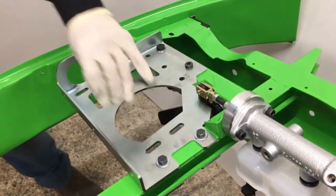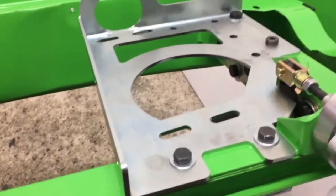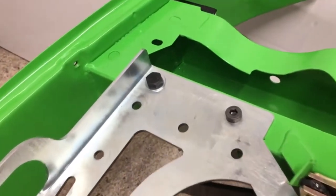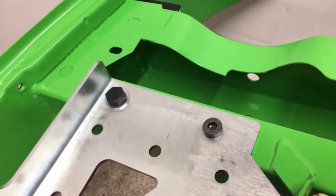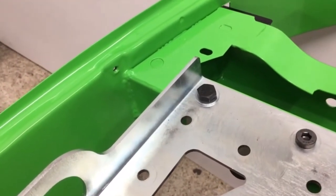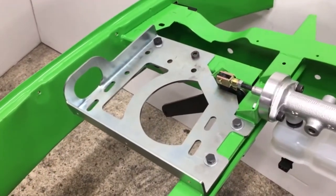This time we're going to use the torque wrench again but we're dropping it right down to 10 Newton metres, because we've got a very soft cross member — that's two millimetre wall, maybe 2.5. That's the second one done, so that's all the mounting bolts taken care of. We've got the two small M8s at the back just done, the cap head M10 — very important that it's a cap head with no washer — and the M10 by 25 at the front of the chassis. That section is complete.